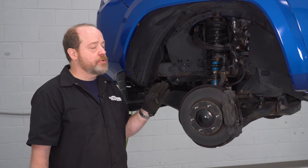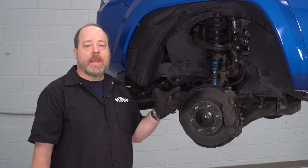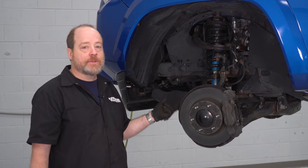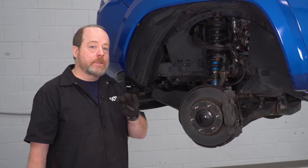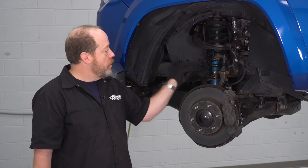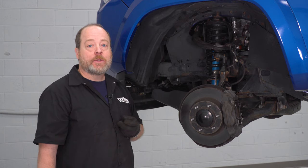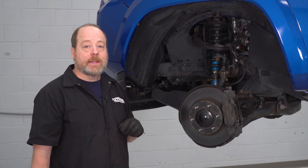At this stage, you're gonna have your truck lifted and wheels and tires removed. Make sure when you're lifting your vehicle that you have strong, good-condition jack stands underneath the frame of your truck and have a floor jack ready to be able to manipulate the suspension. What we're looking to do is only loosen and remove those components that we need to in order to get our strut out. Then we're gonna bolt on the spacer block to the top of the strut tower and reinstall it.